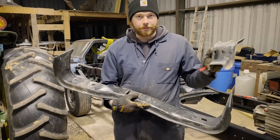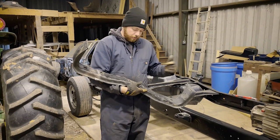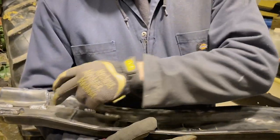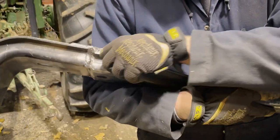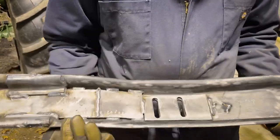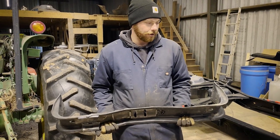So what we did is we cut this piece off down here on the crossmember. So we got that off, took both sides of this right here so that it'll saddle on the frame. We're waiting on the transmission bushing to come in this afternoon. We'll get it mounted up. But you can see right here, what we did is we cut the shoulder off of this one, trimmed it down. We got Jermichael to weld it in here. We put the bracing in right there. And then we cut this piece off because the slots wouldn't line up, and welded it back in here just to give it a little bit of extra support. But that's how you make a crossmember for a Cummins with a ZF6 on a Ford frame with a square body.